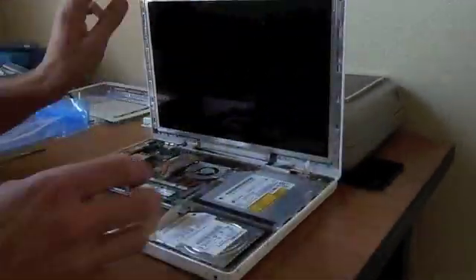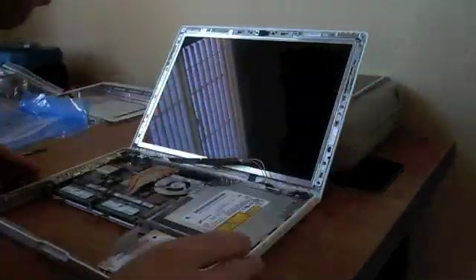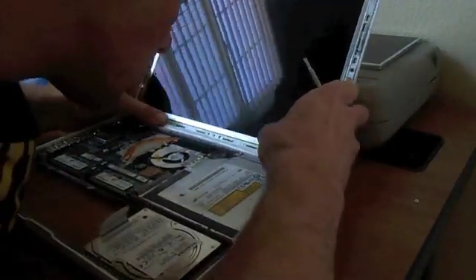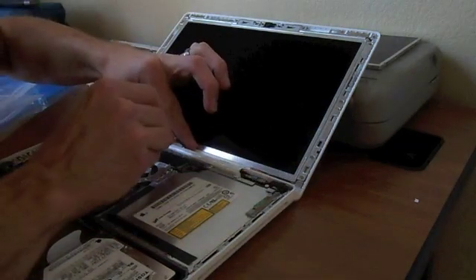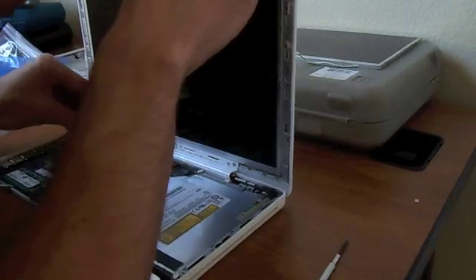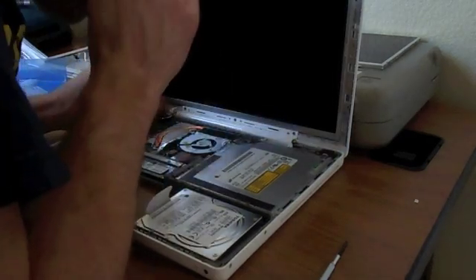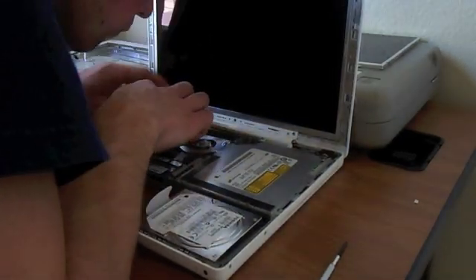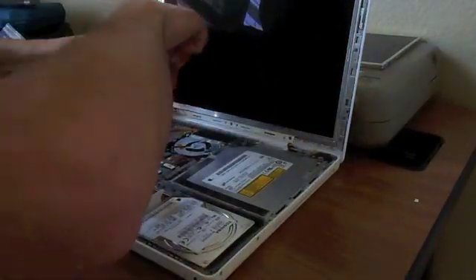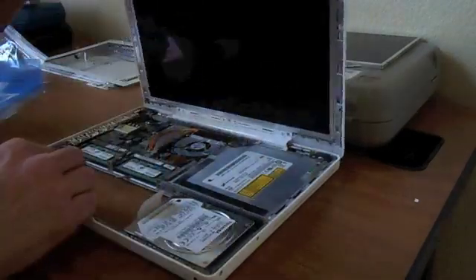Also, while you're taking it apart, note where the wiring is — you don't want any wiring to get pinched by anything you're reinstalling. Plug the actual panel in, then put the inverter cable back in. Put that little plastic piece on with the three screws, and make sure you note where you're routing the wire for the inverter cable. Then put those two little mounting brackets on either side of the white plastic piece that covers the inverter cable.